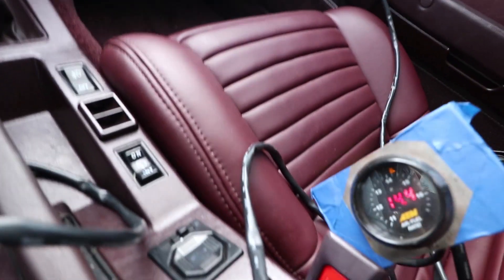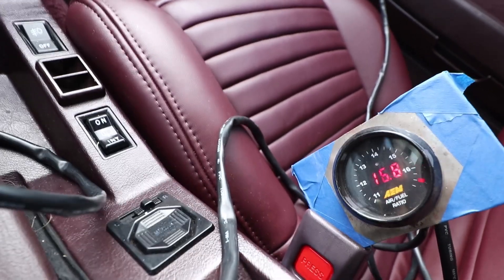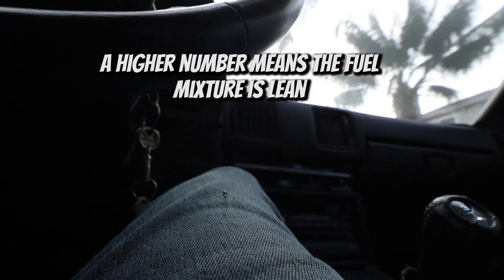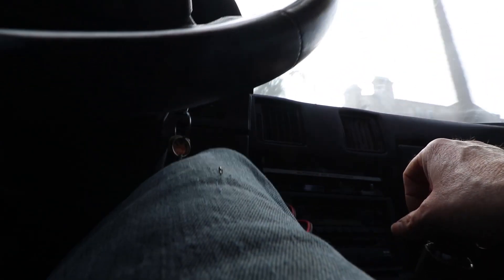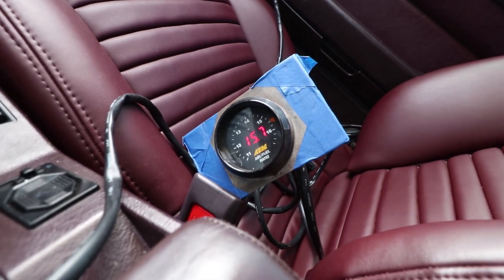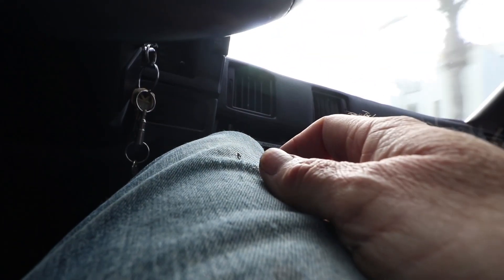It's most noticeable in first gear, although I do feel it in second gear too. This is second gear right here. Just a real subtle little dip in output, and I know it's because it's running lean just for a momentary second. Hold it right there at that lean spot — that's about 3600 RPM with a little bit of brake on, so it has to be just the right amount of load on the engine in order to confuse the ECU.